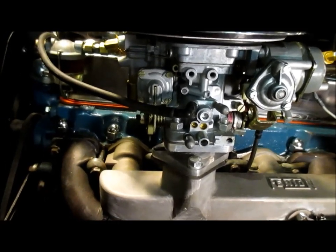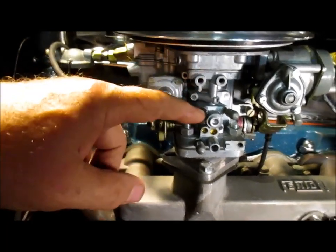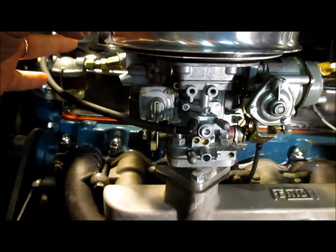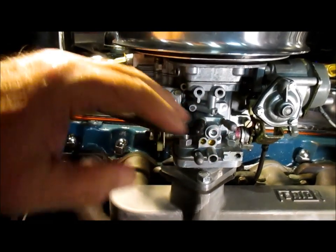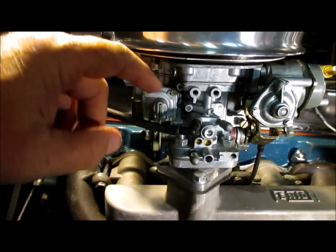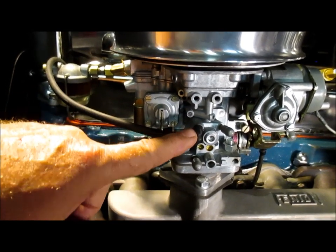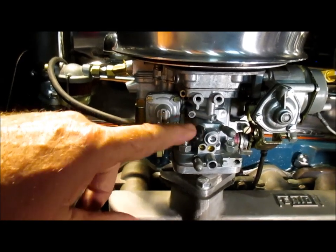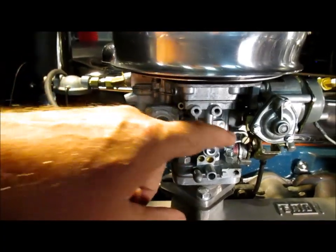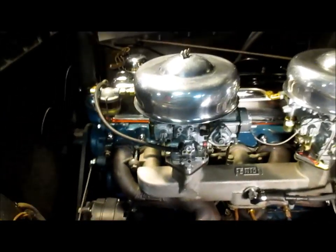At this point, I'm going to continue to run with this port while I continue to fine-tune my timing, and I will be going back and forth every now and then to determine which is best. But at this point, utilizing this port, which is for emissions control, is actually working better for me as a vacuum advance source for cruising than the actual labeled one. If you follow me on that, well, then that's good.